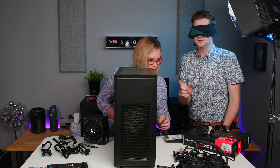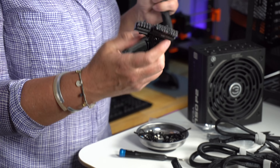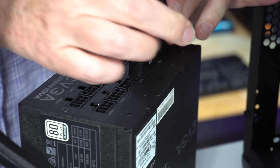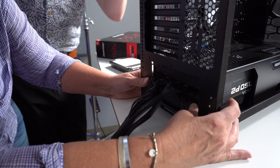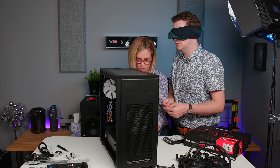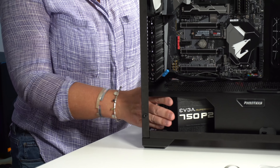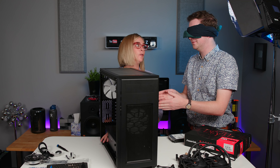The two-part side is what you're plugging into the black box. There are two MB slots — plug each side in. Did they snap in? Yep. I don't see where it screws — the screw holes are on the outside, but where does it screw to? To the inside of the power supply. Maybe I have the power supply going the wrong way — do you have the cords hanging out the side? Oh yeah, I think I did it. The end without cables goes against the back.